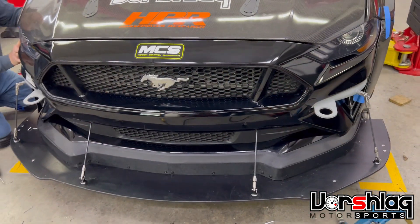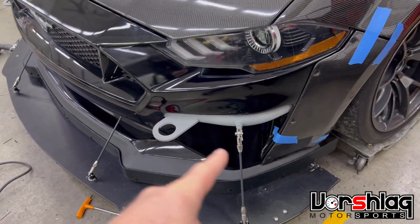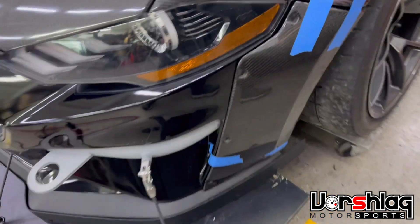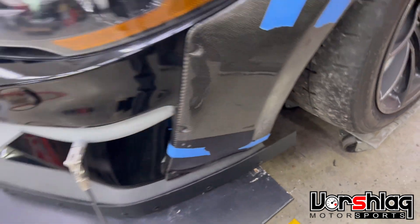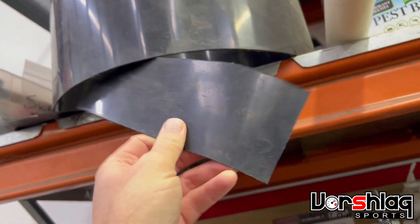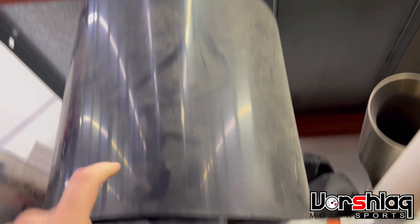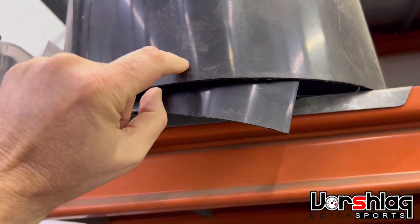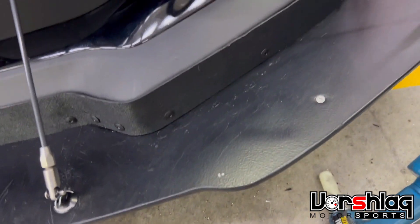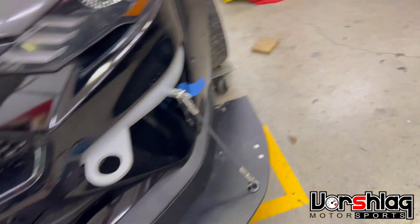We're not doing that on this one — we want it to be recognizable as a Mustang. Some people don't care and they want to reduce the drag of all these weird little openings. It came out really nice. He's still got to trim this — it's a flexible ABS plastic. Many times we'll use this material called race roll. You can buy it from Summit and Jegs and those kinds of places. It comes in lots of colors, it's fairly inexpensive, and it's a bit more flexible. In some of these tighter corners, we used a heat gun and got it pushed in there, and he kind of started here and drilled and riveted and riveted and went and just kind of forced it around.